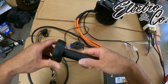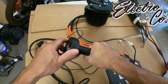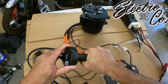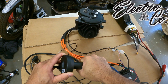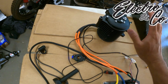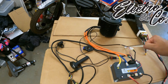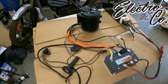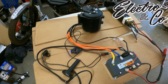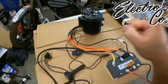This is pretty awesome. You'll notice I'm going really slow on the throttle because this motor has so much torque. Since it's not mounted down, if I jerk it, it's going to twist itself and I don't want that. But just check it out - very smooth. I can almost imagine how smooth it's going to be when it's on the bike. We can get good throttle control kind of like our electric motions, where we can put all that power to the ground and get a really good drive off the wheel. For the hard enduro stuff, we want steady linear power so we can get traction.